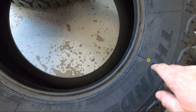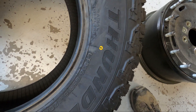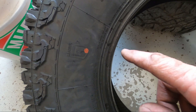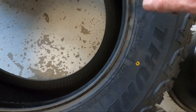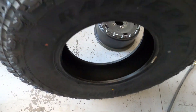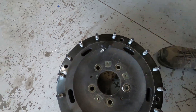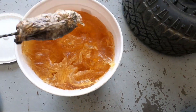One thing you want to do — you have the yellow dot on the tire, so if you put this next to your valve stem on a normal wheel that gets you really close to being balanced. On a Ford rim, a red dot lines up with a little notch ground in the bead on the rim — the heaviest part of the tire is opposite of this, and it helps to balance it out. I'm going to put the yellow dot opposite of the lug for the CTIS system since that's probably the heaviest part of this wheel.